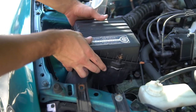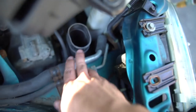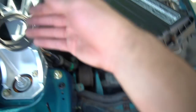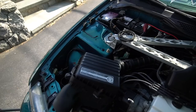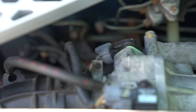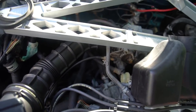Once you take that third bolt off on the bottom, the entire front assembly comes loose. In this case, you do have another section of the intake that goes under the car into the front bumper. I'm just going to leave this in because what this does is suck air from the front of the car up into these, and once we put the aftermarket intake in, these holes will line up with it and it'll work just fine. Now your next attention is going to be coming to the intake manifold itself, where you will see a hose clamp with a little bolt. Take that off and the entire assembly of the intake will pop right off.